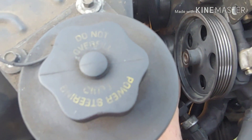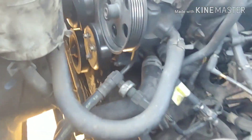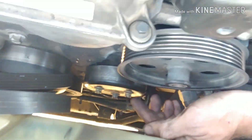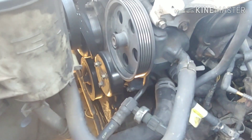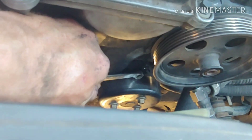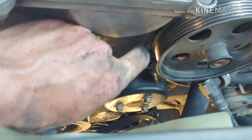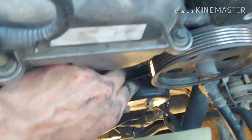Now let's see — we can get to that one, no problem. That's the first one. There should be one right here where my finger is that I should be able to get, and then the one below it I know I can get because I got to it on the other one. So we get to the water pump bolts — it's eight millimeter or a 5/16, depends on what you have. It's accessible; we've got this one right here, you can get on from the top.